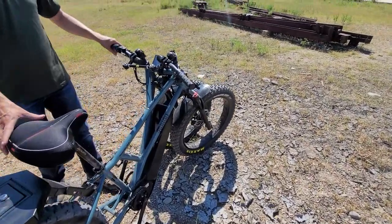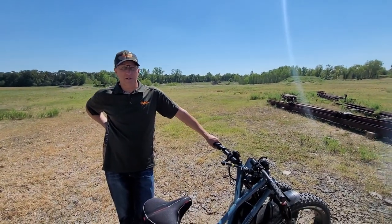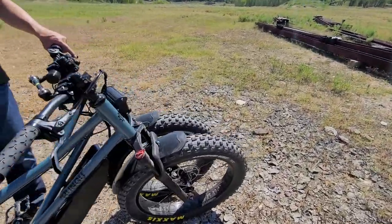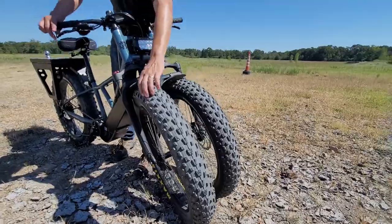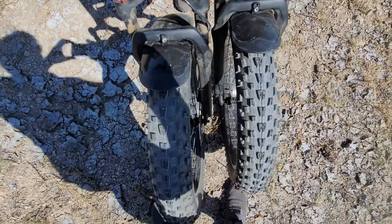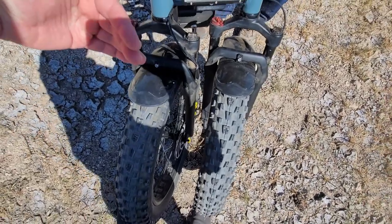So what is the purpose of the two front wheels? The classic question. If you've ever ridden a motorcycle or a bicycle on dirt and had a wheel slide out from underneath you — called a washout or a low side crash — that's what this prevents. When you're riding on just one wheel, all of your grip is coming from those knobs on the ground, so it just takes a little sand or dust and you're on the ground. With both wheels in contact, you have the full surface of the wheel — no side slip. That's the basic physics: eliminate washout, so you can get your stuff into the backcountry and back.